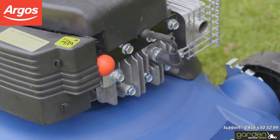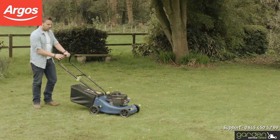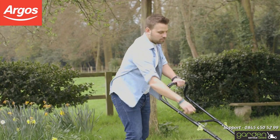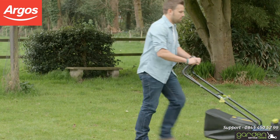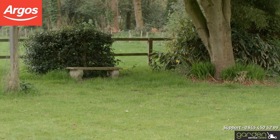If your model has a start-stop activation bar, pull the starter handle and rope from the pull cord gently until you feel resistance. Now, pull quickly. If your mower fails to start after 3 attempts, repeat the starting process. When the engine starts, gently return the starter rope to the pull cord guide.